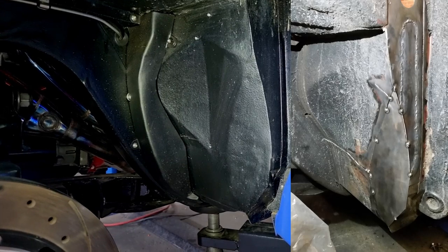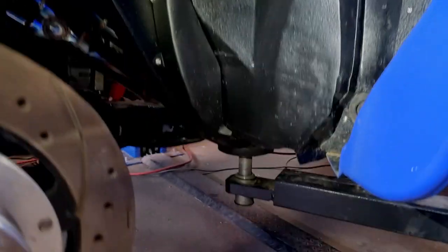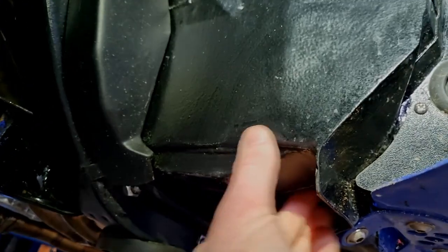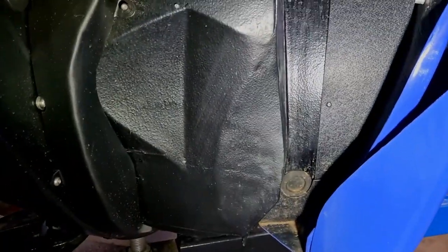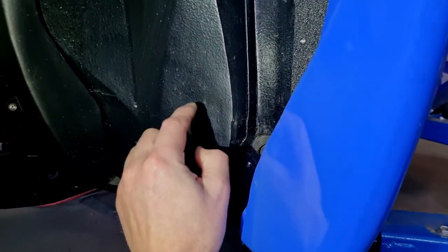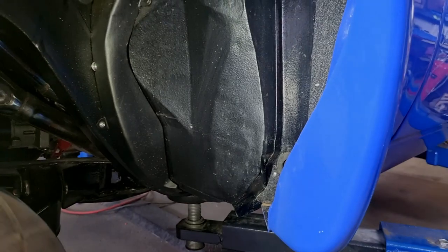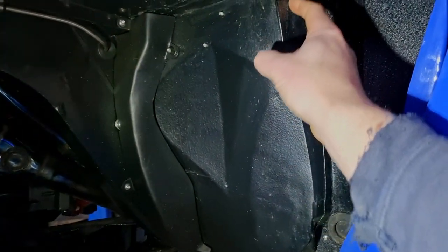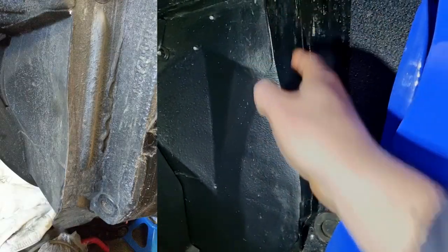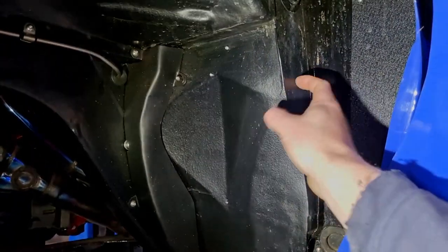There's like a tiny bit left at the top. This kind of diamond shape I just made myself — I'll put some photos in that demonstrate how far I cut it back. That's basically in line with that box section bit of the chassis. I just went straight from there vertically up, and the profile looks a little bit funny on the angle but basically that's just a straight line in both of those planes. I just welded it on and put another weld where the floor on the inside of the car meets the new piece — just a MIG weld there, and that works really well. Originally they do have a recess here for the wiring to pass through, allowing wiring from the dash to go down to the sill area.